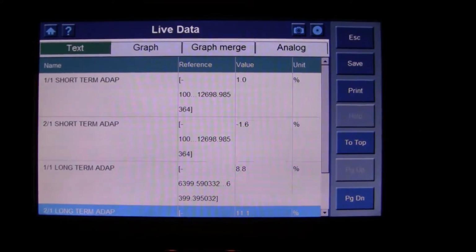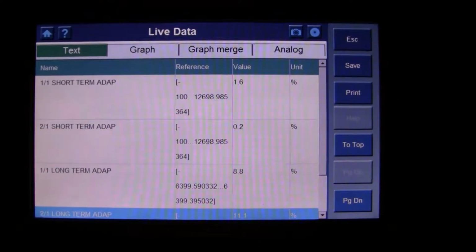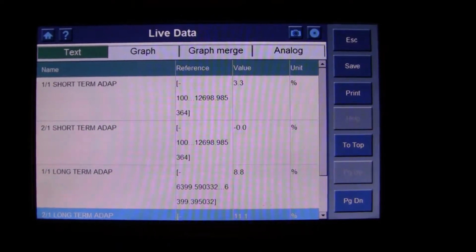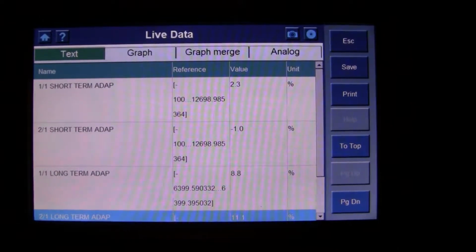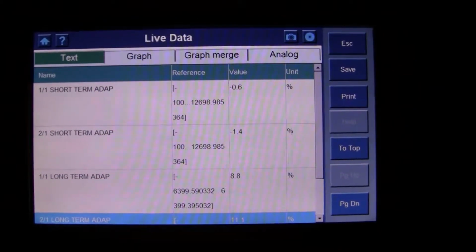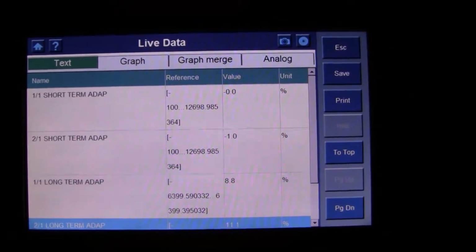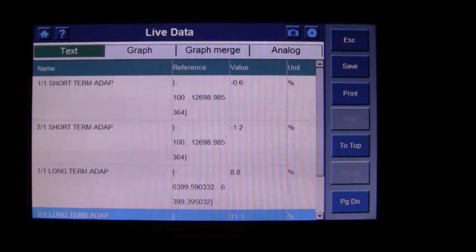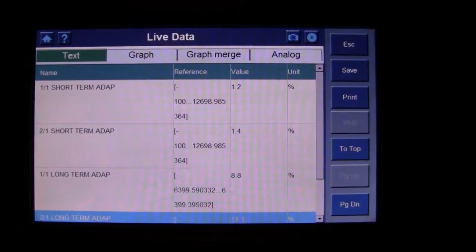Like I said, I looked all over the place. I couldn't find any vacuum leaks. The tube that connects from the airbox and goes around and hooks up to the back of each valve cover in the rear area, that plastic tube, I did replace that because I found some cracks on there that could be causing some pirate air. So it doesn't look like the long terms have started to adjust yet.